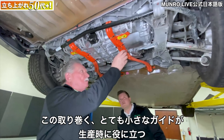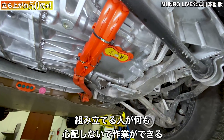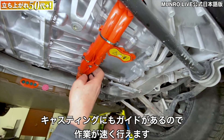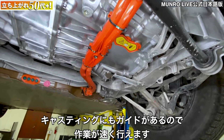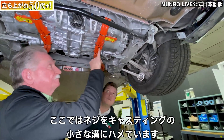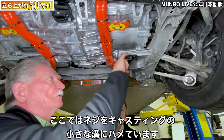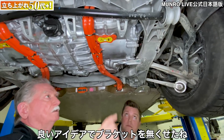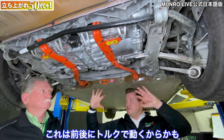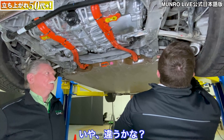The way they've got these little aids for manufacturing is cool — a single screw and a couple of wire ties means the operator has no issues putting things in place, just up and in. The casting itself is giving us the guidance needed to put that thing in quickly. Over here, you can see they've screwed into a little boss that was cast in place. Doing the same thing for the shield bracket would have been a cool idea — getting rid of the bracket, nuts, and everything else.